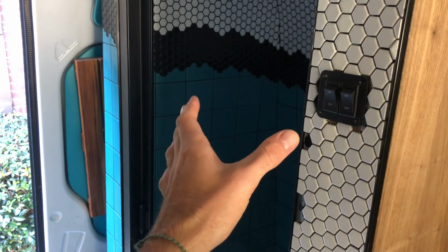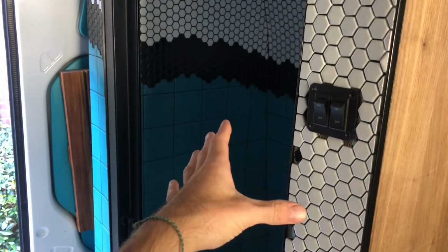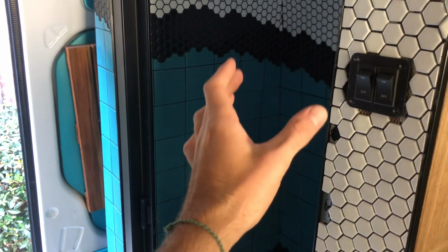So on this side I'm hoping with 3/4 inch plywood and tile and a toilet that this will help with the weight distribution. And of course I've still got to put on my face frame and my front panel doors, which is all 3/4 inch plywood. And I'm guessing that weight will somewhat equal this weight, because the construction of this is all 1/4 inch plywood and steel studs. So besides all the tile, that's pretty much all the weight that's on this side.